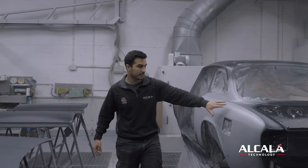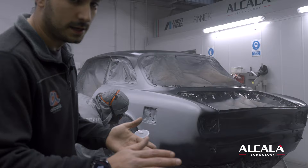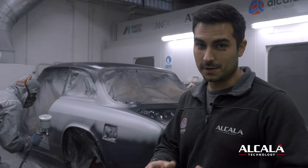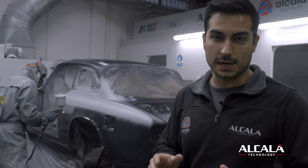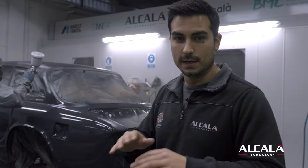You can see the light gray is on here and the dark gray we have here. Tomorrow it will help us to find all the surfaces that were a bit not great, or to find the little issues we couldn't find when we were working on the shape. Tomorrow I will send you a video because we will do it in red — I want the car totally shiny. Once we have the car totally shiny we will see all the defects, all the wrong surfaces. We're working hard to finish this week and have every single detail of the car totally ready to fit the mechanics.